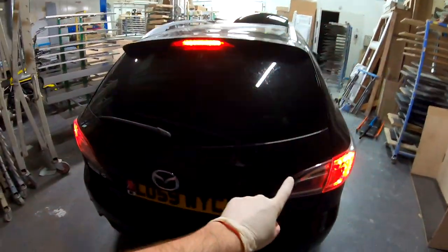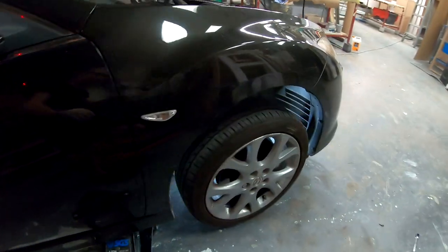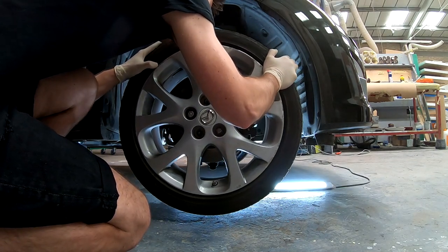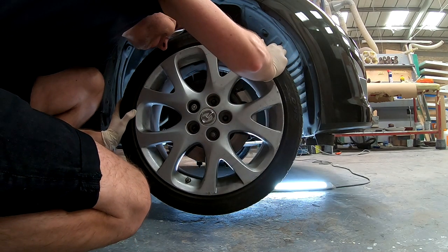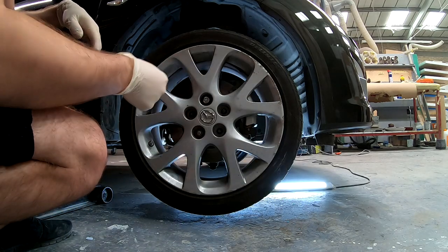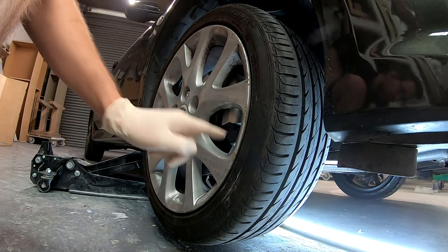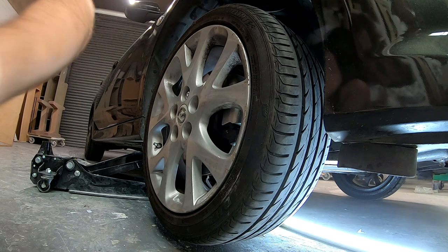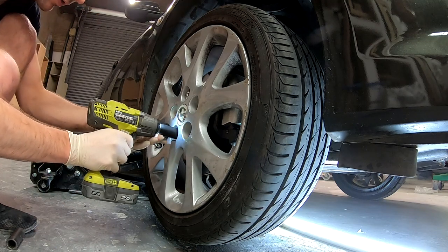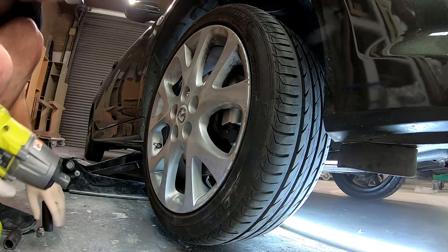So you can see the brakes are on — I wedged the brakes — this should not spin. It's not spinning. I need to use force just to spin it, and I didn't even press the brakes fully. Now take off the wheel and check if there aren't any slow leaks behind, because slow leaks can happen. If you run out of brake fluid you'll fully run out of brakes — that's not something anyone wants.